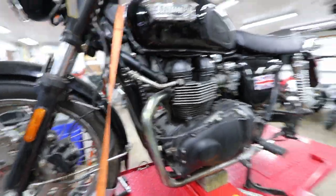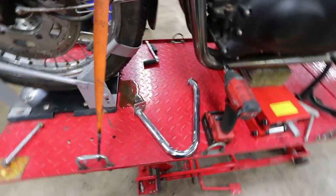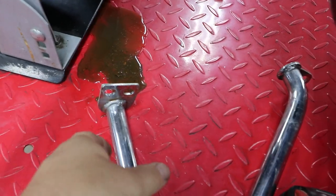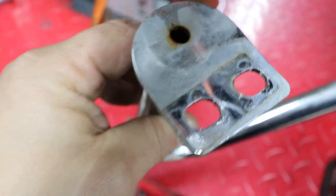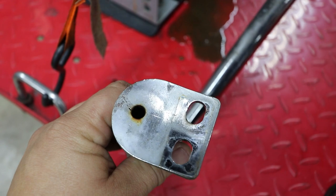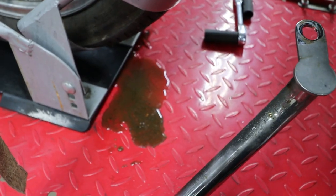The top has these two hardened bolts and then two welded steel nuts on a plate on the other side — super easy, this thing is a breeze. While filming, I walked back over and noticed an entire puddle down here. The crash bars had water and junk all inside there and it leaked all out — that's a pretty bad design on their end. When I get this back from the powder coater I'm gonna dry that up, spray some sealer inside there, and then cap this off. I don't want this to rust from the inside out.